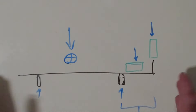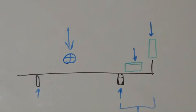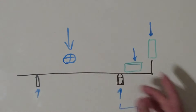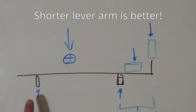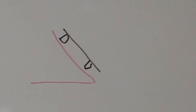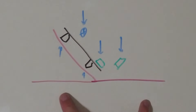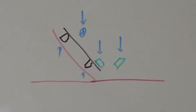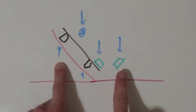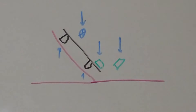Some people will note that vehicles have suspension - this diagram doesn't account for suspension. The effects of suspension compressing and decompressing on the front end in this case are minor. Really what I want to get at is the distance from the spare tire force to the rear axle, because that is essentially a lever arm and it lifts up on your front axle, leading to adverse performance effects. It also affects you on hill climbs because that spare tire so high up puts a torque on the chassis which reduces front axle grip on steep climbs. The vehicle going up an incline exaggerates the loss of traction on the front wheels on hill climbs due to the greater distance from the rear axle. That's why I'm locating the spare tire here.